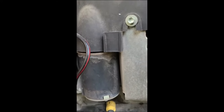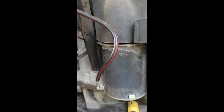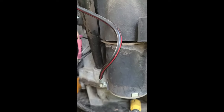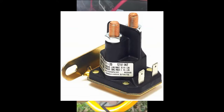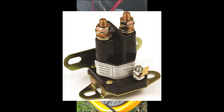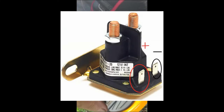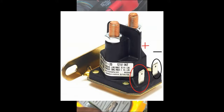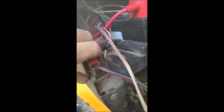The Briggs and Stratton has a gray wire that goes to the carburetor — you've got to have that because it's an electronically controlled carburetor. You've got a magneto that charges and one that goes to the lights, and then they change wire colors to confuse you. Now your solenoid — this is actually a four-point solenoid with two big wires and two little wires. If it has two big wires and one little wire, it's got a body ground. If it has two big wires and two little wires, then you've got a positive and a ground. When you put power to the little wires, it makes a big switch make contact between the two large terminals — just like running a screwdriver across it.